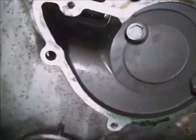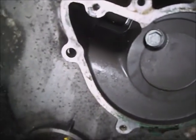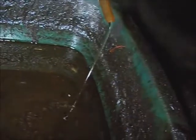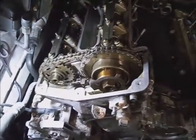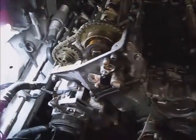I'm going to stick a plastic hose back in that hole and see if I can drain any extra antifreeze off, just to help keep it from running into the motor — and it does have some in there. While that's draining, I'm going to roll this motor around to top dead center and get these cam lobes pointing at one another, at least 45 degrees toward one another, before I start taking these covers off.